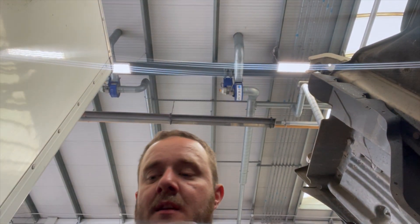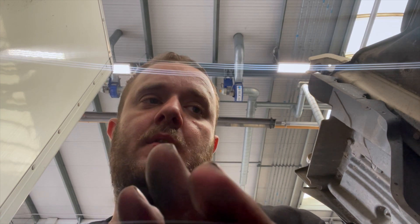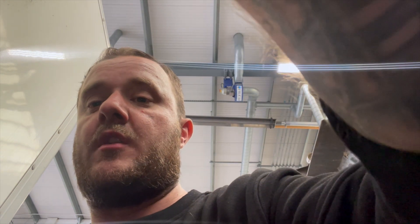You join me the next day — got an engine knock, it's quite bad to be fair. I've had a look at the top end, can't see any noise, nothing's loose or anything like that. It's hard to pinpoint where the noise is coming from. The thing is it's intermittent, it's not all the time, so it makes it maybe not mechanical — it may be actually electrical, IE injectors and stuff. So at the minute I'm currently blanking off the injectors, one at a time, blanking each one off, start it up, see how it sounds.